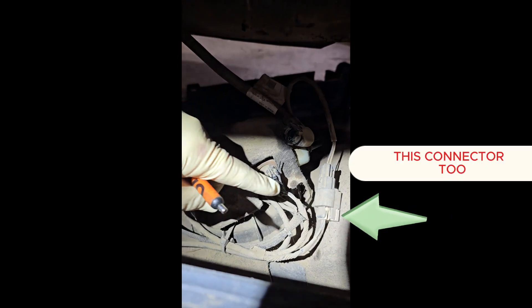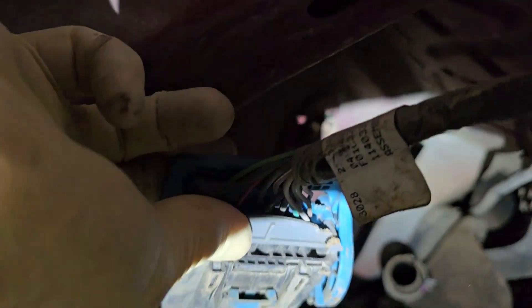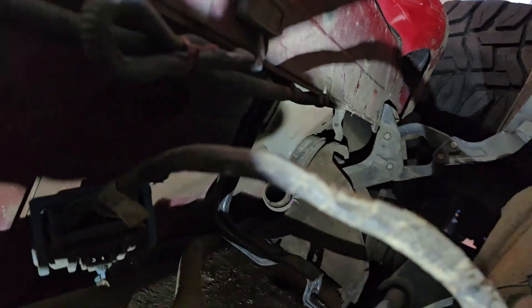It's going to make a mess — there's dirt everywhere. You don't have to disconnect the hose yet; you can wait until you get the tank partially dropped down for more access. Put a paint marker across it so you know exactly where it's supposed to be when you're done so you don't have any leaks. On the way down you're going to undo the vent and the fuel line. Then disconnect the connectors — there's a bulkhead up here with a clip, pop it out off the top of the frame, and you can bring the whole harness down with the tank.